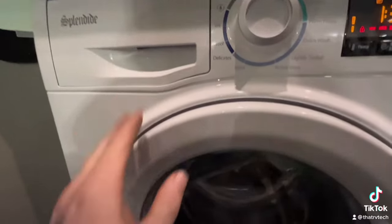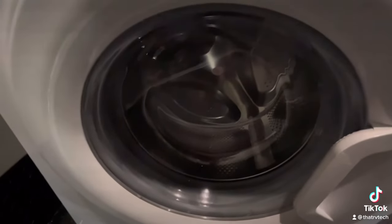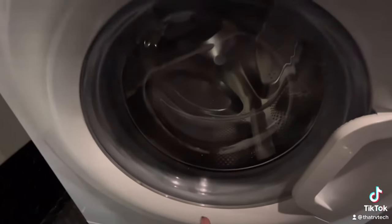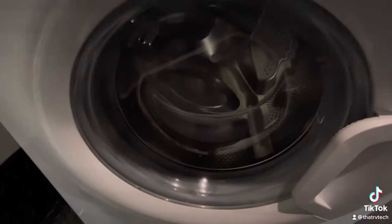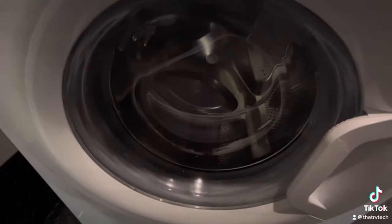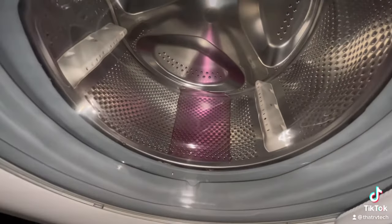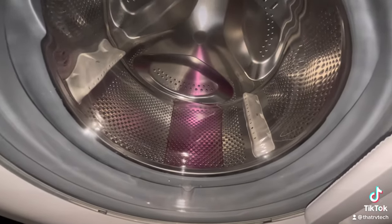You don't need much to get into the valves — it's the drain pump you have to worry about, and that's the part a lot of people also skip: the drain. You need to get enough antifreeze in to start filling it up and see it building up a pool in the bottom. Usually 30 seconds to a minute — you don't need a full cycle of water, but you do want to build some up. Now we've got a decent amount of antifreeze inside, and I'll show you how to get the drain to activate.